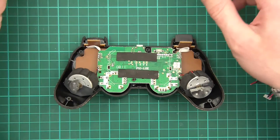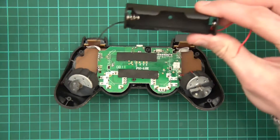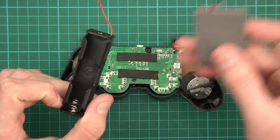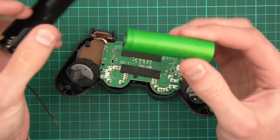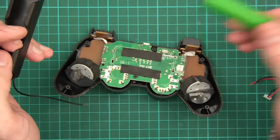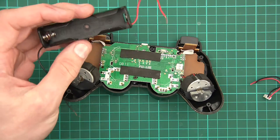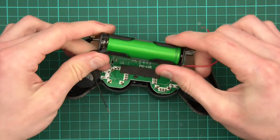I decided I'd do something different. I'm going to put a lithium-ion 18650 cell on it and glue it to the back. These lithium-ion cells are also 3.7 volts, but they'll probably be more like 2,000 milliamp-hours — I could safely assume over 1,000 anyway. So it's over double the capacity. The downside is of course it's quite a big thing, but I don't really care. I'm not a big gamer at all, so I'm just going to get a good connection and solder it in.